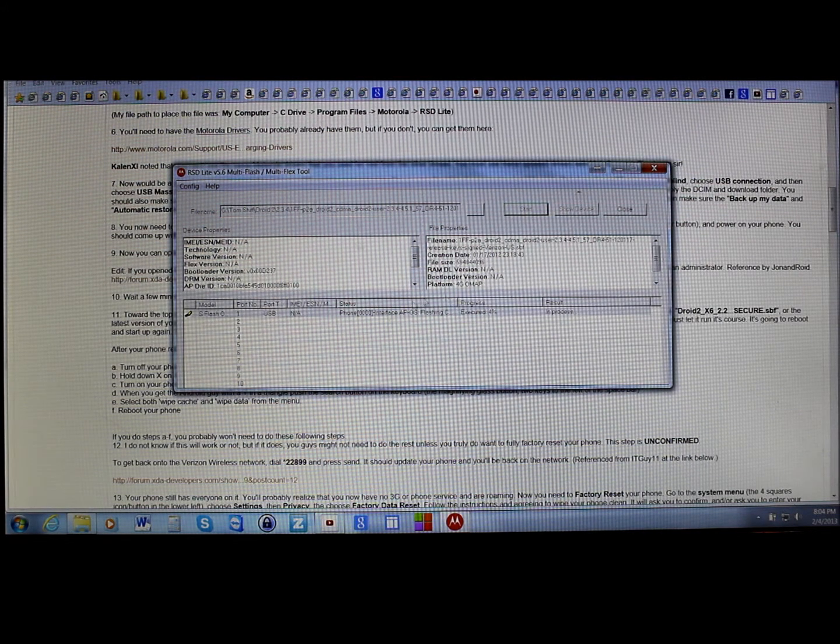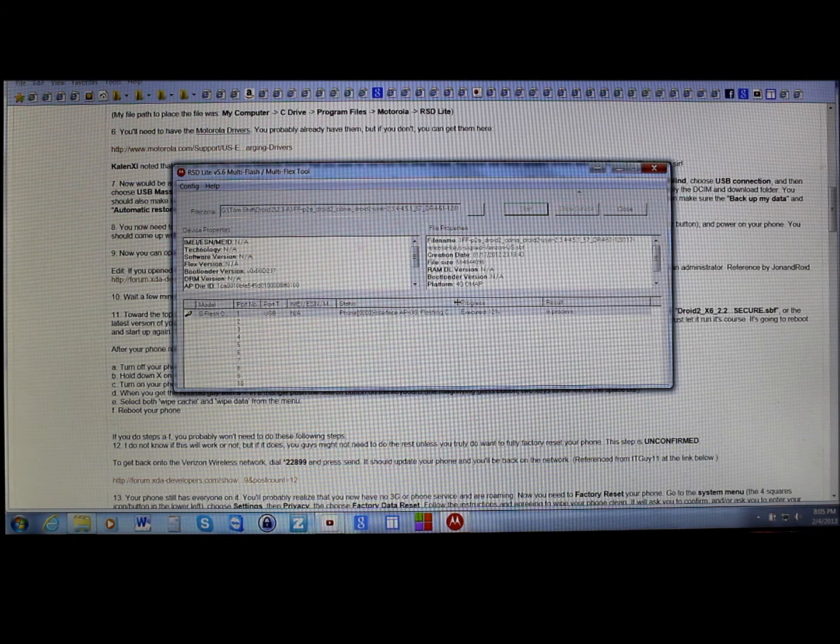At the end it is going to reboot the device. Also, definitely do not unplug your phone during this process — if you unplug in the middle of it, you could hard brick the device, and if you hard brick it you can't recover with this method; it'd be a paperweight. Also, make sure you have at least 80 to 90 percent battery, preferably 100 percent, before starting. If you lose battery in the middle of this, the only recovery would probably be a factory cable to reflash.